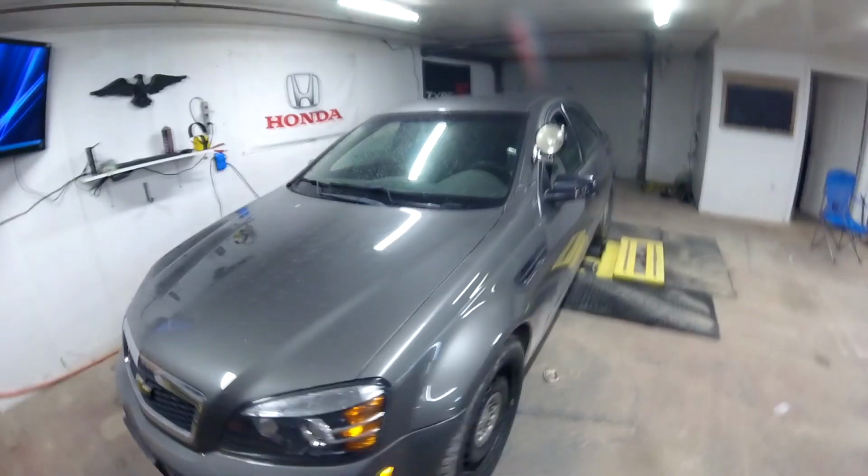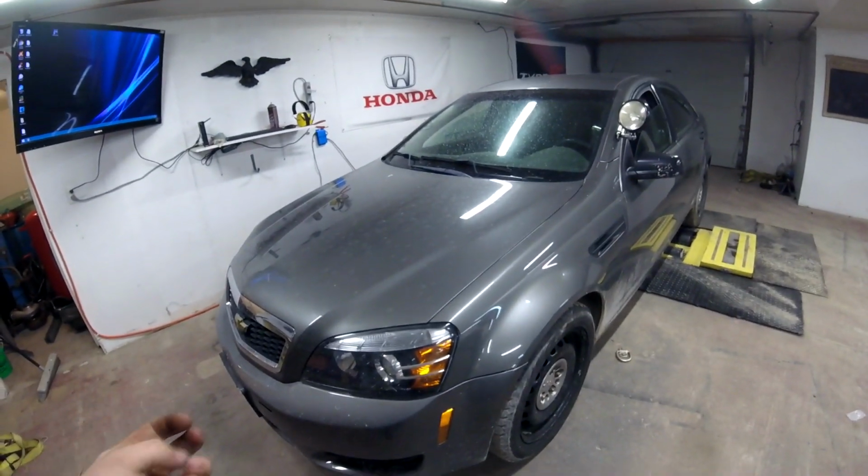And it also started to back up the turbo, which Varen actually was telling me, like, hey, if you ever have problems with any of these VS Racing turbos, it's a couple things. It's an oil feeding or backup issue in the turbo. And one of the things he recommended to me when we first started playing with this car, it had a bunch of turbo problems because the drain was actually put in the wrong spot. So the drain was backing up into the turbo, and it's kind of acting the same way now with the broken piston having a lot of crankcase ventilation. Same kind of theory, it's backing up into the turbo with crankcase pressure.